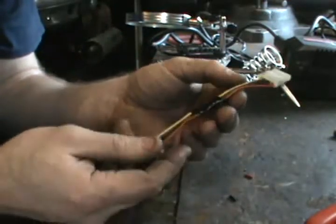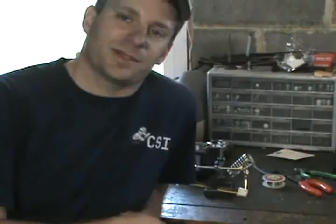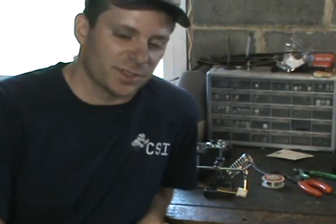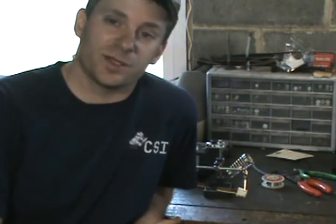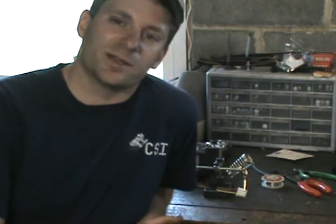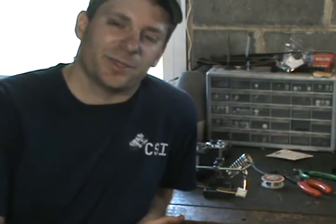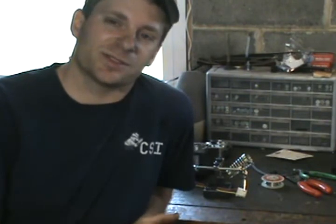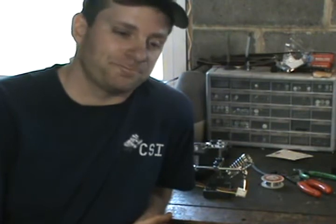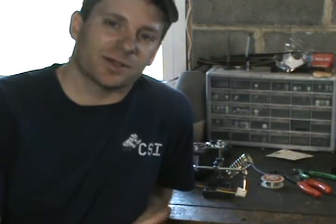If you had more room you could go longer with it, or take the time to remove every little connector and insulate it longer. For the most part, that will last forever. It's one of your most common entry-level soldering joints and it's used quite often — probably on installing radios and aftermarket stereo systems. It's the best fail-safe way to do it. There are other alternatives like wire nuts, crimp connections, butt connections, but with multiple connections I don't really suggest those because later on you might find you didn't have one of those connections crimped 100%. So take the extra time — it might cost a little extra money — but solder it, heat shrink it, and you can guarantee the customer will never have a problem with that connection.